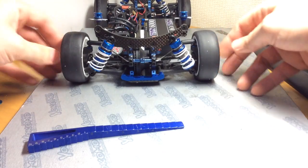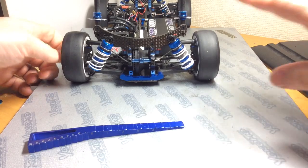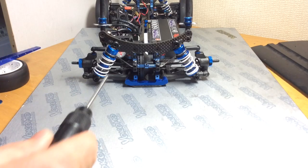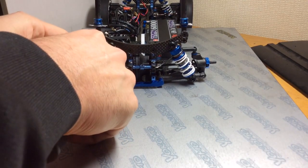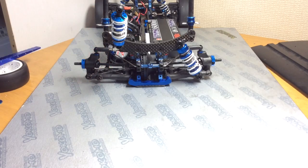So what we're going to do is take the wheels off. Since this is just a demonstration, I've just moved the chassis forward so the front end has dropped off, so the suspension is no longer working on the front end affecting the droop. What you want to do is move the gauge out of the way, take your shocks off, disconnect them from the arm, and also disconnect the roll bar. Right now I'm just going to leave the roll bar on for demonstration purposes.